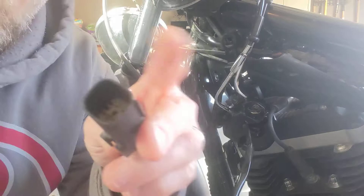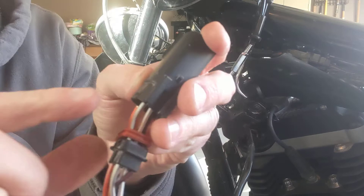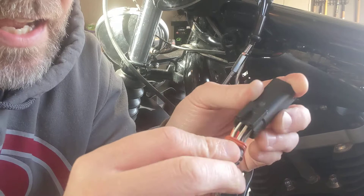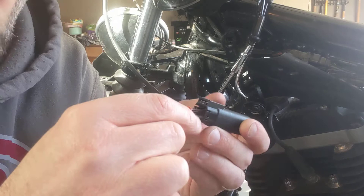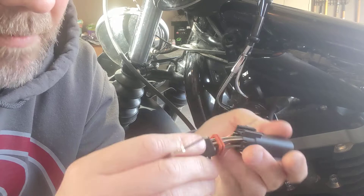Here's my right controls with a wire. First thing you want to do is get this guy off of here, and you'll see a little tiny hole right there on the side that you're going to want to use a real small screwdriver and wedge it up in there and lift that up just barely, and go to the other side as well. Get in there, lift up, and then that snaps this guy loose and you can take that down away. And then inside there is a weather stripping to protect the wire from water and moisture. You're going to want to get this same screwdriver and just kind of dig in there and pry that rubber piece loose and scoot it all the way back.